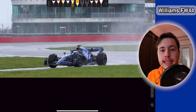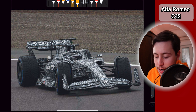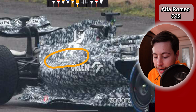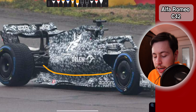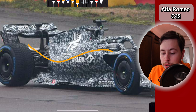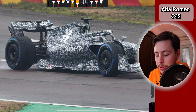We don't have a lot of pictures, so let's go right through to the Alfa Romeo. The Alfa Romeo was actually caught doing an unscheduled shakedown event. Unlike the Haas, and I know you cannot see it very clearly because of their camo livery, but what you see right here are actually cooling louvers. So the Alfa Romeo, just like Aston Martin, is trying to create that big undercut right here. You can see the contrast with the Williams — whereas Williams creates an airflow that speeds up and goes down to pull the air from the diffuser, the Alfa Romeo is trying to accelerate the air in the bottom section of the coke bottle to generate the same effect and to pull the air from the diffuser in order to seal the floor.